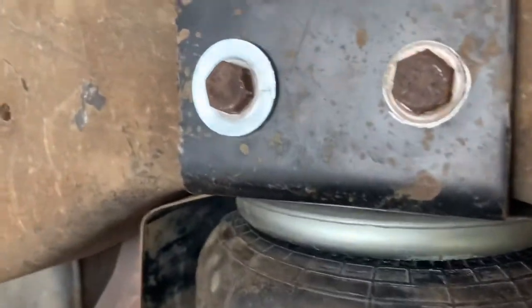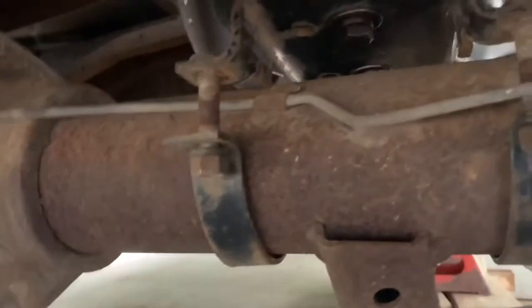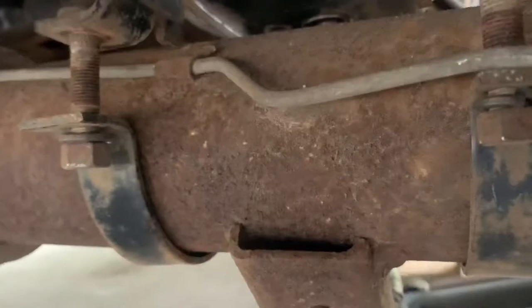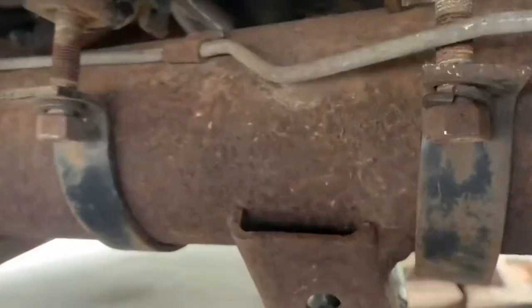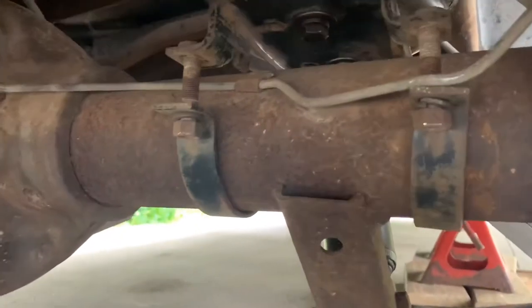The top bracket's in, installed. There's the heat shield — see how the exhaust is right there? That's why the heat shield's right there on this RV. Your applications could be different for these airbags, but for my RV that's what they are. Down under here, right here is where you want to get your mounting brackets in — see those? The U-brackets. Make sure that this is in its natural state, not cocked or anything. I shake mine around a little bit just to make sure it's sitting right where it needs to be, and then that's where I tighten it up.